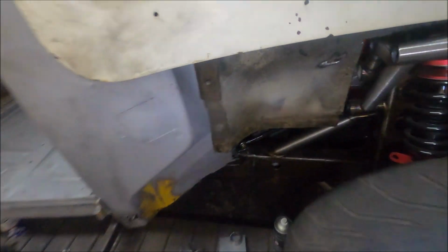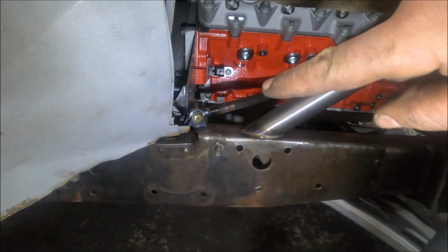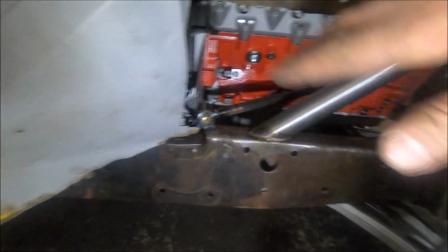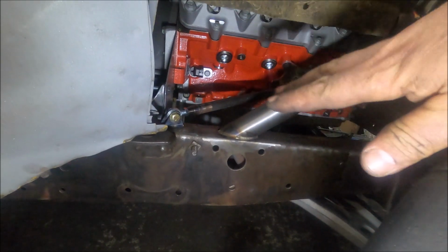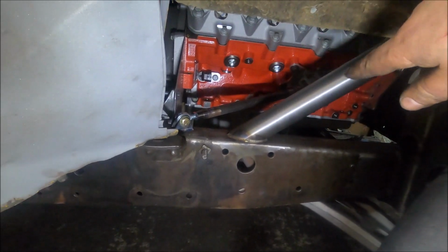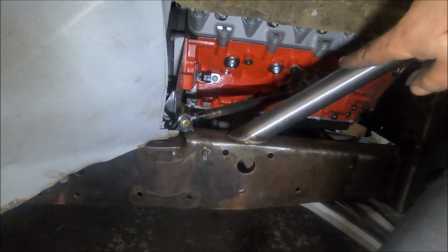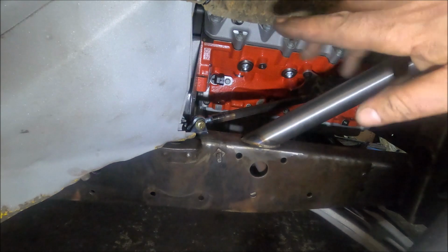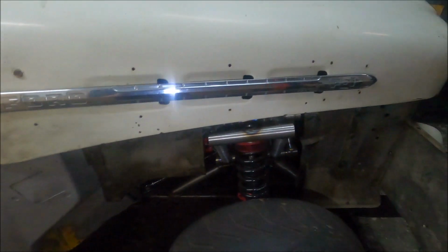It's got engine plates, front and rear, and Motion Raceworks arms on the side, because the motor plates might stop it rocking side to side, but can't stop it moving forward and back. So you need some kind of mount, and Motion Raceworks in America make these badass adjustable ones that you can just fit. So Thomas bought them, and yeah, looking pretty awesome.